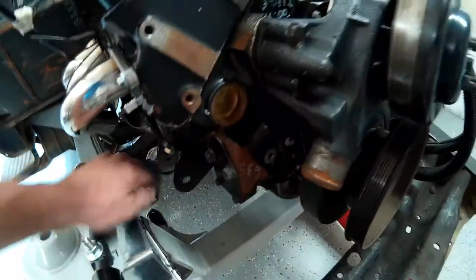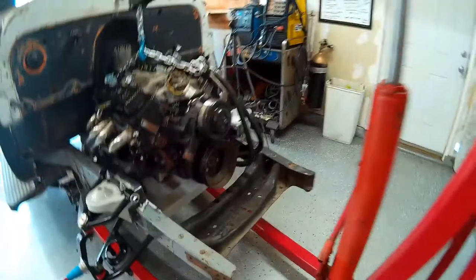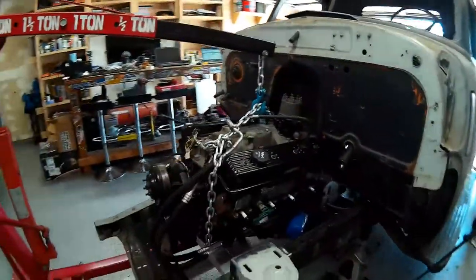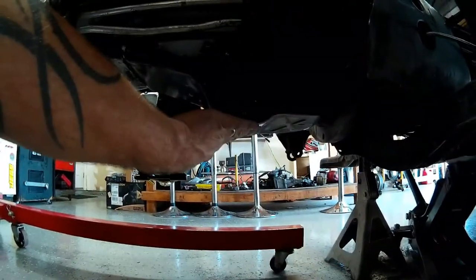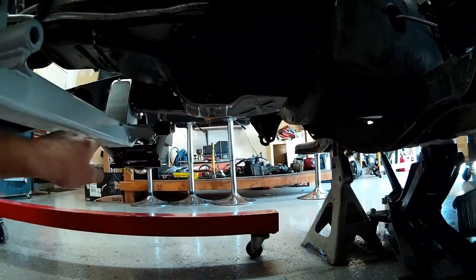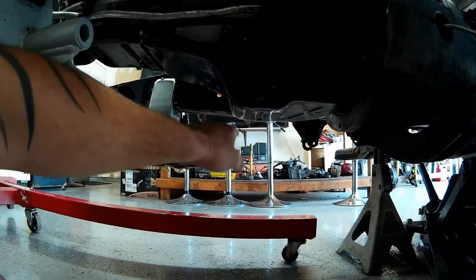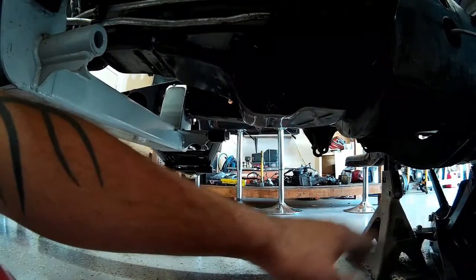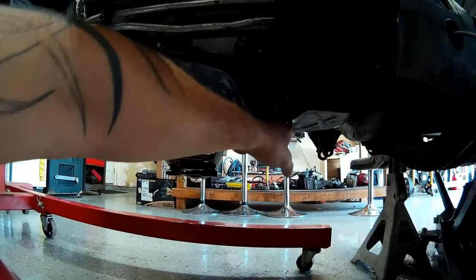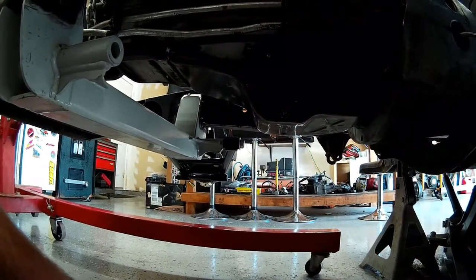I've got plenty of room in here for motor mounts and lots of room under the pulley. I would have liked to have it sitting lower but I had to make a concession. In order not to crush the oil pan or rip the bell housing out of the transmission, I made sure that the bell housing was the lowest point, level with the cross member. That way our oil pan is up and protected by the cross member. If the truck is set down all the way flat on the running boards, it won't be sitting on the oil pan - the lowest point will be the bell housing.